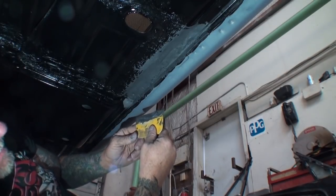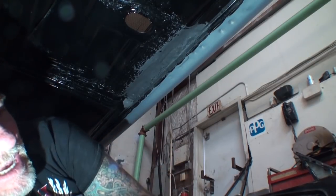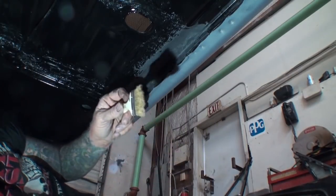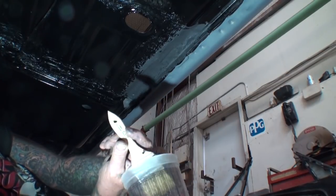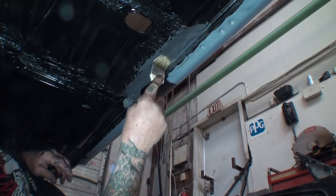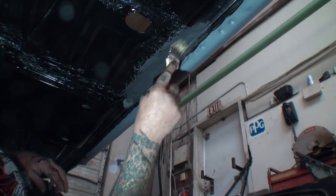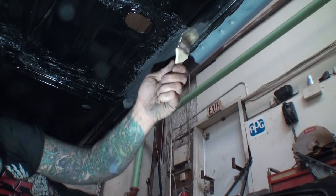Okay. All right. So now that we got that done, the next thing we're going to do is clean that up. And the way that we're going to do that is we're going to take our acetone and our brush. We're going to dip it into our acetone. Let me lift that up there. We're not going to get a lot on there. And then we're just going to brush it, just like this. And what that acetone is going to do is smooth it out and feather everything where it blends in with the rest of the metal or the vehicle, where you won't even know that this was done.